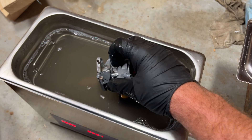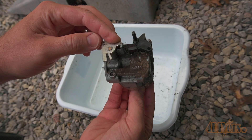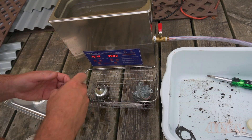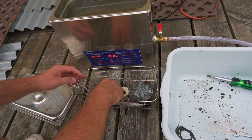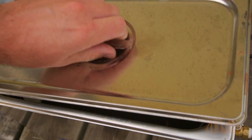You can see the carburetor has came out quite a bit cleaner. Now for the next example, again is disassembly of the carburetor. Again those components are placed in the basket. I'm using the same dirty water and soap solution mixture — I do find that this can be used quite a few times before needing to be replaced. Once the ultrasonic cleaner is on you can see the debris clouds coming off the components. I do find it is extremely important to have the solution heated as it does aid in the cleaning process.